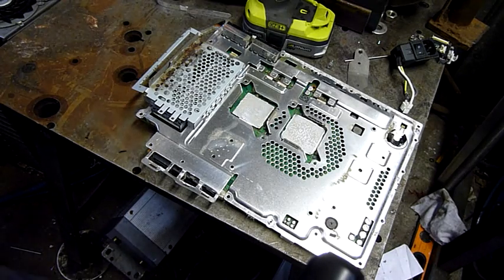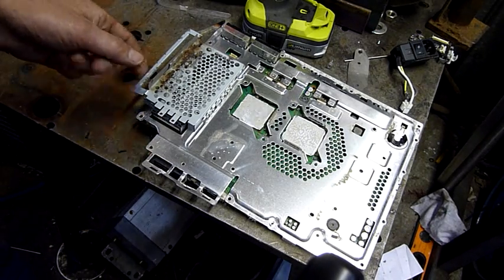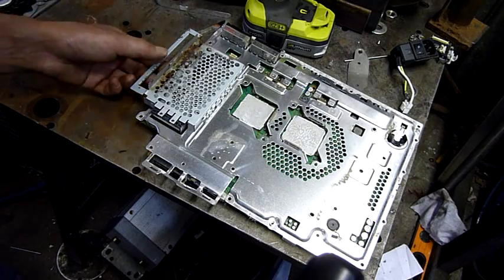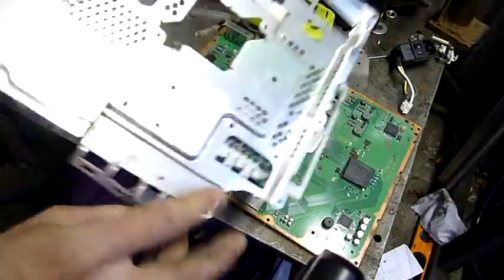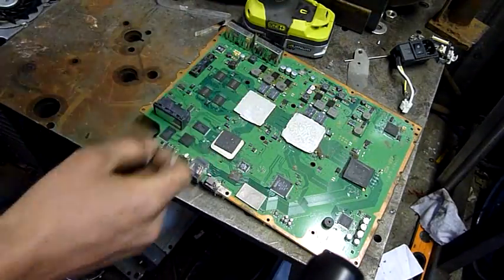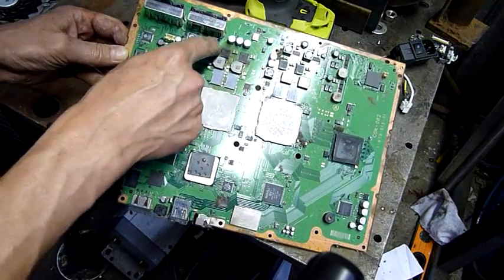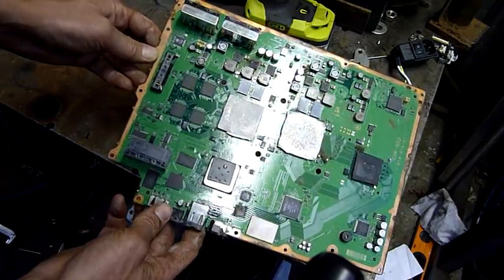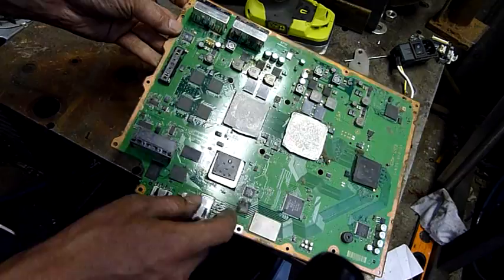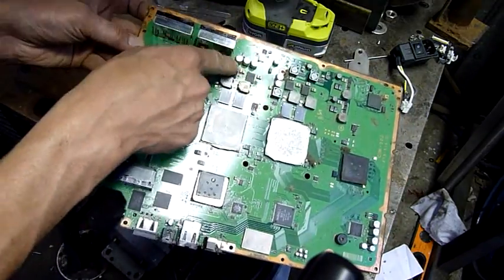What we've got left is the main board assembly. Taking two screws out of the expansion slot caddy or hard drive caddy — this unit didn't come with a hard drive. We can remove the lower heat sink — just alloy plating, not much to it. There are some components that look like the voltage regulators got fairly hot — I can see yellowing on the board. Lots of corrosion around the outer edges where it's been drenched in water. I've been smelling cigarette smoke residue as well. The padding from under the chips has definitely gotten pretty hot.